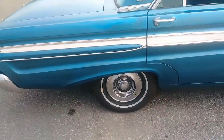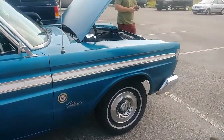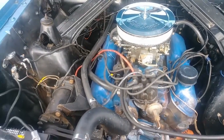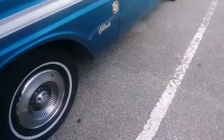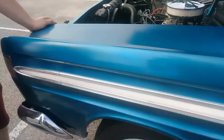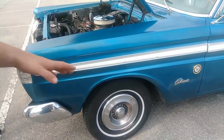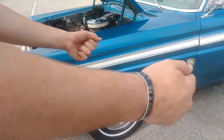I love the shape of how they have it here. Is it drum brakes in the front? Oh yeah, but this brake kit is only 450 bucks. Are you trying to do all four swaps? No, just the front. The reason I was so happy I found them for 450 is instead of replacing the spindles, the kit goes onto the spindle so you can keep the knuckle. That's so cool.